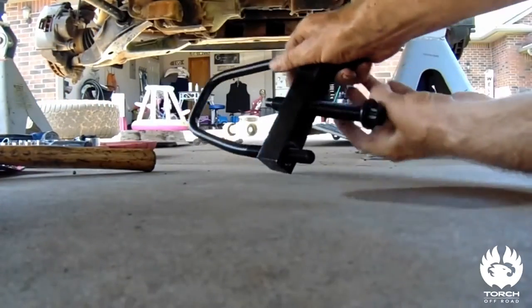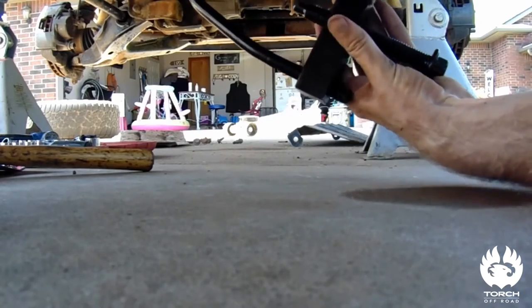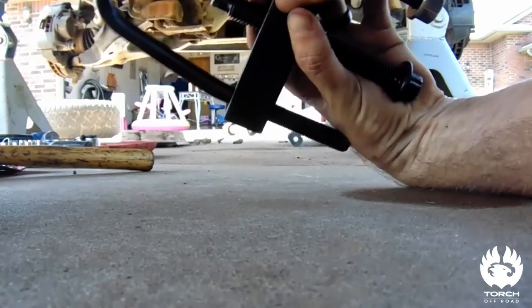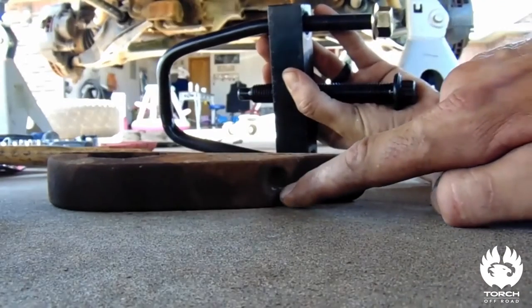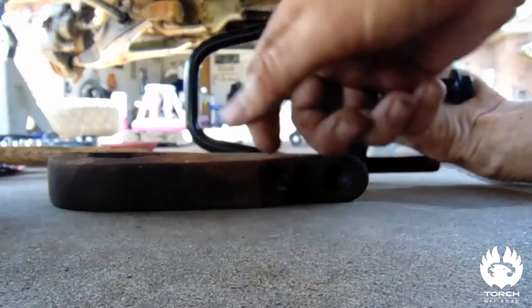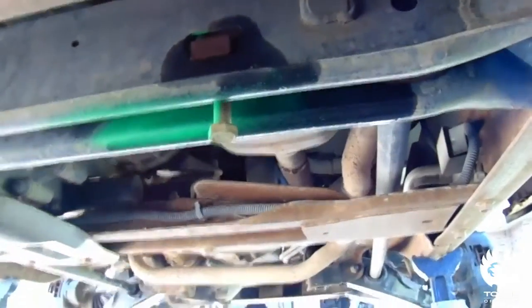Here's a better look at the tool. I'm laying underneath this thing without a very good tripod. This hoop goes around your crossmember up here, comes right down and meets with your block. You put these nuts on, tighten it all the way up, and then this goes in on the torsion bar key. There's a little groove for it — that's where this point of the tool goes. When you start screwing this in, it puts tension on it and allows you to unscrew the torsion bar set screw. I painted it neon green so I can see it on the threads.